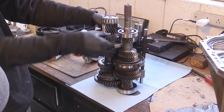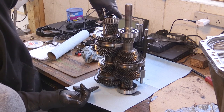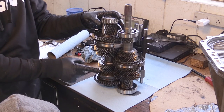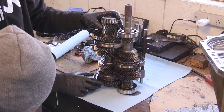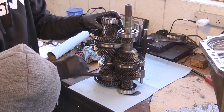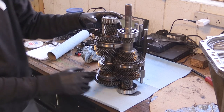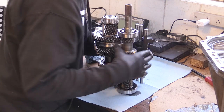Can you tell right away if 5th gear is the problem? It'd actually be the synchro itself that's worn, not the gear most likely. If you catch it early — if you keep driving it while it's grinding — you'll eventually do damage to the gear as well. But typically it's the synchro that wears out first. Usually I'll do a new synchro and a new slider. One sign you can use to test the synchro is to see how much wear it has — I'll pull it all apart to show more.